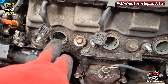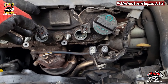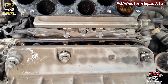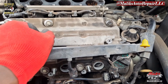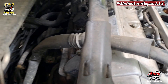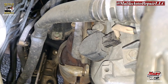Now we can take out the coil packs. As you can see, we got 10 mil — two of them holding this bracket. With that gone, now we have access to all of the bolts that are holding down the valve cover. See how we're exposed now? We're going to pry up on that and get it out from under this harness. Let's start on the rear — just because I don't want to risk dropping anything in the front of the engine.